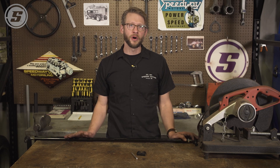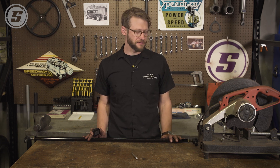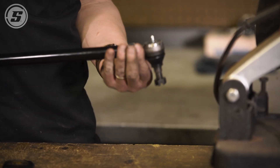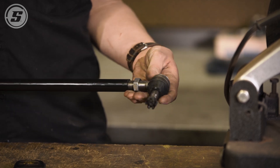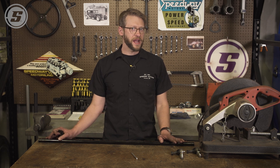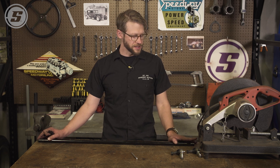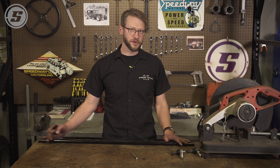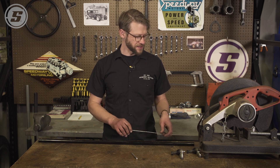We know our overall length is 38 and a half inches, so that means we're going to cut our tube down to 35 and a half inches. First thing we'll do is thread the rod ends out on both sides. One thing to keep in mind: most of us have a right hand tap — whether it be 11/16ths like this one, or 5/8ths, or whatever size your kit is. Fewer of us have a left hand tap, so if you're going to cut the threads off of one side and replace them, it's probably best to cut the right hand side off, assuming that's the tap you have.